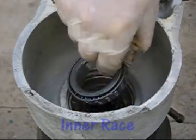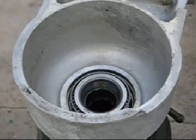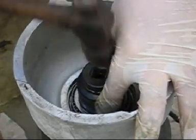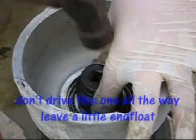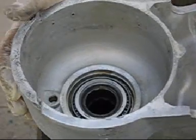The trick here is we want to drift this bearing in, but we don't want to drift it all the way home. We want to leave a little bit of play to take up with the driveshaft later. So that's just right — a bit of play in there now, which we're going to take up with the driveshaft.